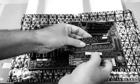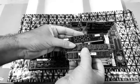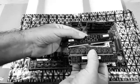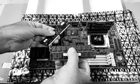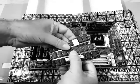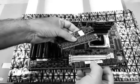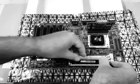Okay. Wait a minute, Johnny. You've got different types of RAM there. We'd like all of our RAM to be the same, so go ahead and set aside the one that looks different. That's better. All three of those look very similar. Be careful how you put them in the slots. They only go one way.